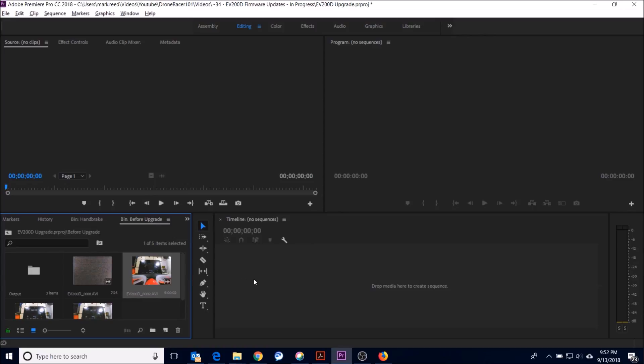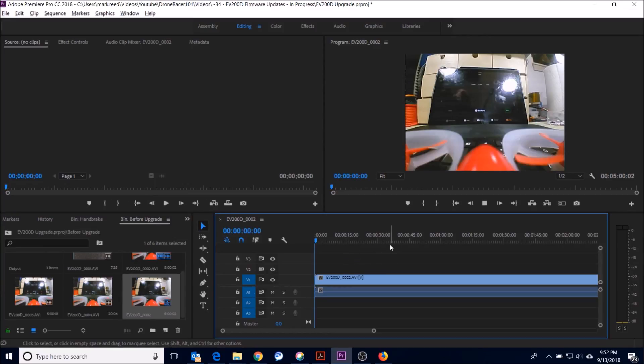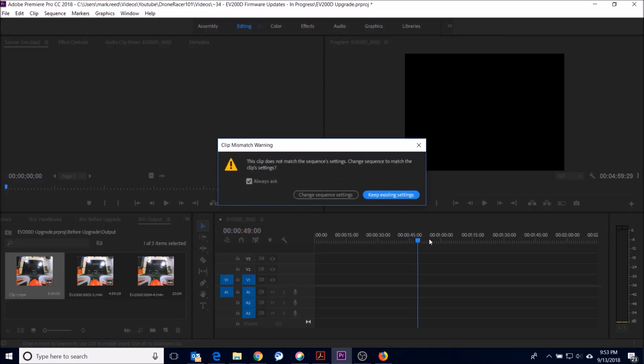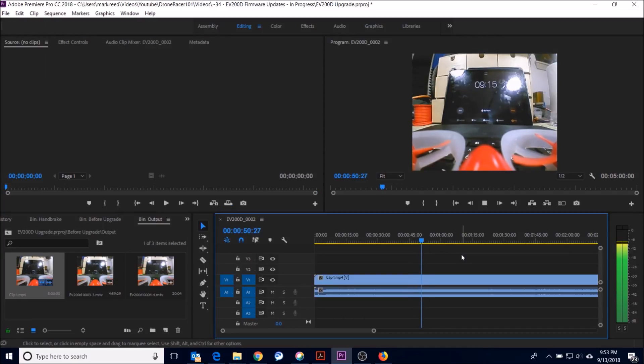Here's one of the problems I have with the DVR. If I go to edit in Premiere and play the video, you'll notice my clock is not moving. I recorded 10 minutes of video just to see how well it would sync up — it was still two seconds off when done. And if I put my videos in to edit them, they just don't work. What I have to do is reprocess them in Handbrake, and then they start working. The native files do not work.